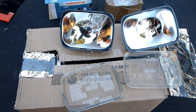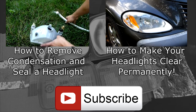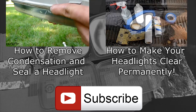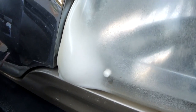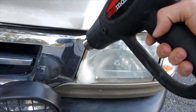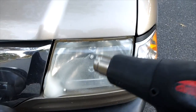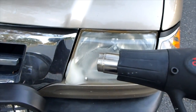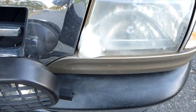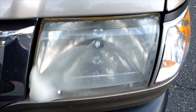Hopefully this video was helpful. If it was, remember to give it a thumbs up. If you're not a subscriber, consider subscribing. Up on the screen there are going to be a bunch of how-to videos — you can click on the screen or find the links in the description below, along with links to the ChrisFix Facebook and Twitter pages. Top tip for this video: you can see my headlight right here is all bubbled up. That happened because I used too much direct heat onto the headlight lens — I was trying the heat gun method to loosen the edges. I also had an issue where even with the heat gun inside the box almost a foot away, it was blasting directly onto the lens and it bubbled up. So: do not allow direct heat onto the headlight. I learned from experience — don't let it happen to you.